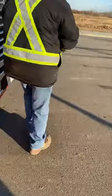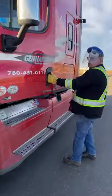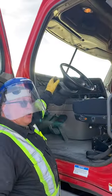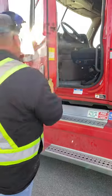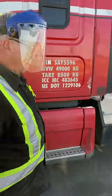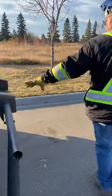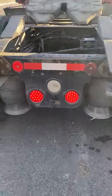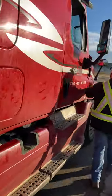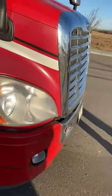At this point just walk around, put your hammer away and secure it. Reach up and turn your high beam off, put the right signal light on. This walk-around is going to be just a little bit quicker — it starts with signal light and marker light, carry on, brake light and tail light, signal light, then signal light and low beam, low beam and marker light.